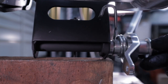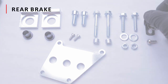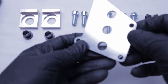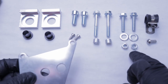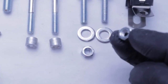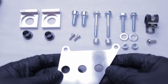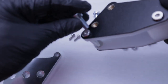On the CRF 70, the outer spacer appears to be a little too narrow, so I'll need to fabricate something there. Now, the components for the rear brake and swing arm: the brake cable guide and related fastener, two bolts for the caliper, a mount for the master cylinder, two nuts supplied to fasten the master cylinder, two bolts and possibly some spacers to hold the plate to the clutch cover, and the chain guide with fasteners for the swing arm.